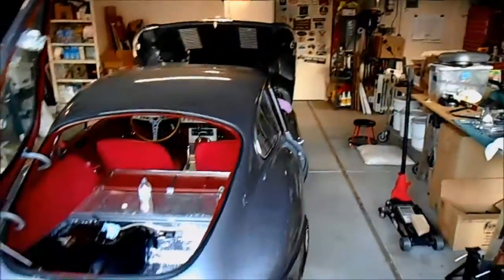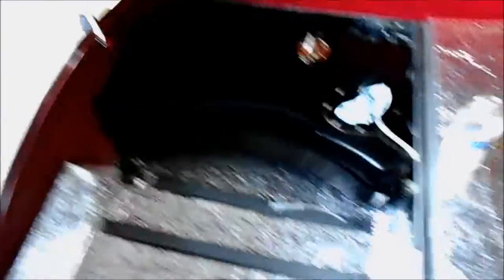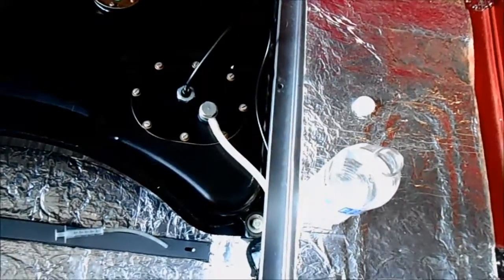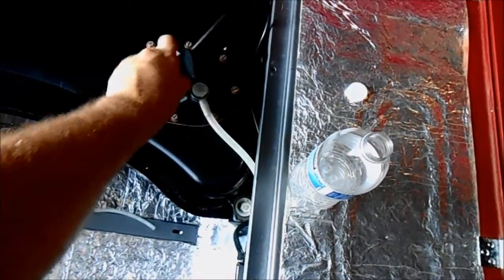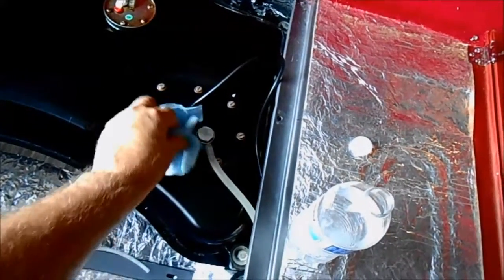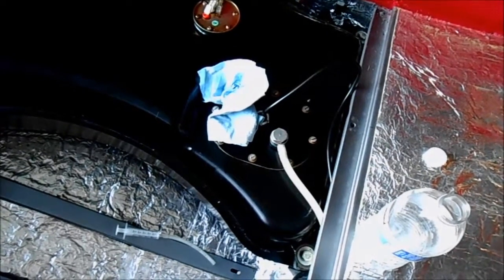Update after the glory of my first drive to go get some gas — we realized we had a little problem. Once the fuel tank was full, it was leaking like a sieve from the submersible fuel pump fitting where the electrical wiring goes into the fuel pump. I had leaks around the gasket too, but that I was able to tighten up. This particular leak just keeps seeping, and eventually the fuel got down into the reservoir where the wire goes, and the pump has stopped working — either shorted out or burned out or both.